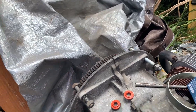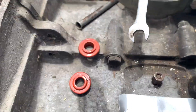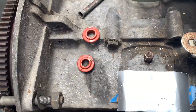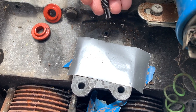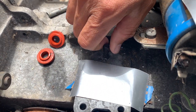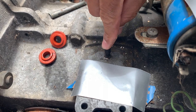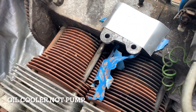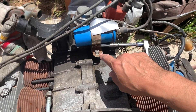I got the two nuts locked on there and now I can just turn it out. You can see the stud turning — there you go, that's the stud backing out. I got the stud out, and here's the new one. This is a six millimeter that steps up to an eight millimeter, so I'm just going to screw that in. I won't screw it all the way down because I need it to stick up pretty far. To see how far, I need to drill out these holes to put the pump in so it can sit flat.